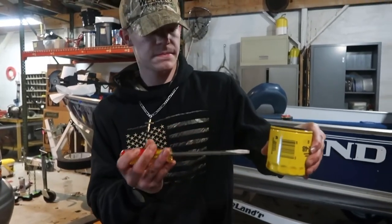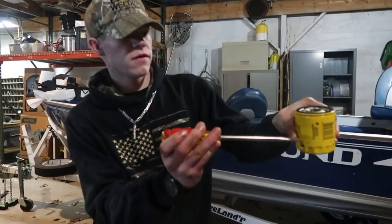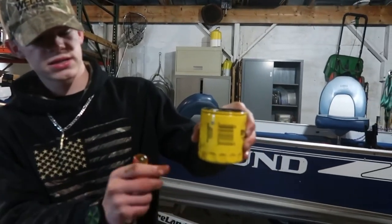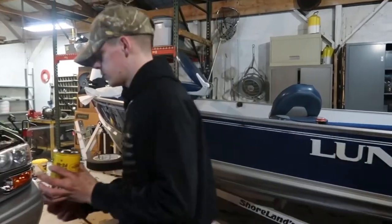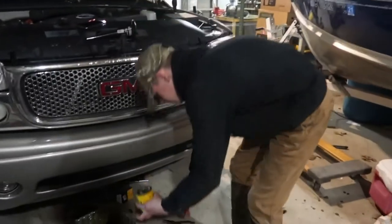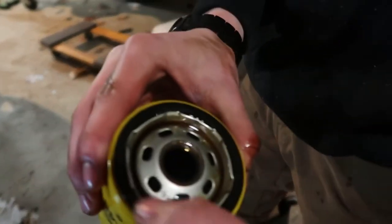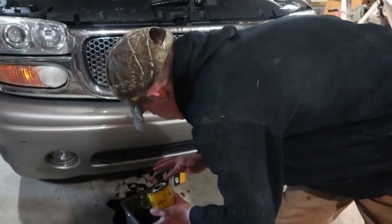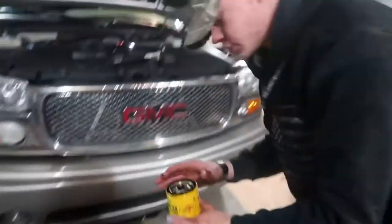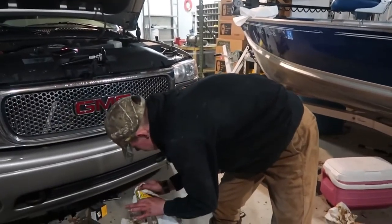If you don't have to pound it to the other side — unless you have a pickup truck, it's easier that way. I just punched one hole in with a screwdriver and mallet, then twisted it off a little bit and let some oil leak out. Then held the bottom with a paper towel and twisted it off. Once you get your new one, you'll see a rubber seal on it — rub a little bit of oil around that seal with your finger so it doesn't crack in the cold. Then twist it on, pretty tight but not too tight.